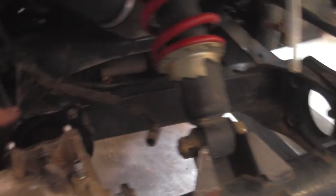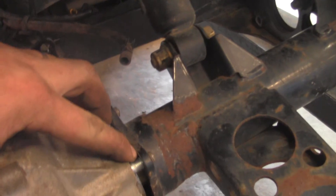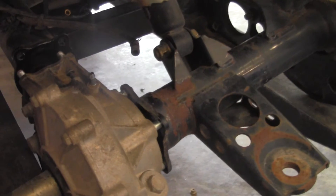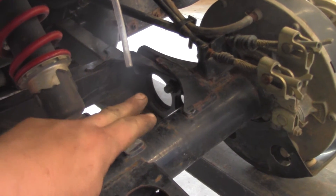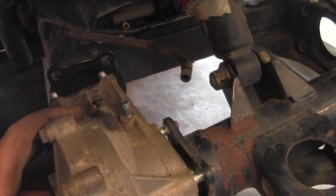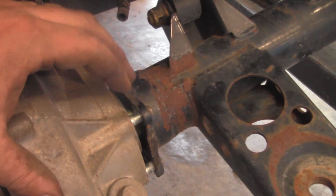It's going to be really easy. There's four bolts here — I've already got it separated a little bit — and then four bolts here, so eight bolts total. Here's the tricky part: these four over here you're going to have to do two; you can access those on the other side of the frame. We have both rear tires off. Once you've got these four over here off, that axle will slip away enough. You have those four nuts off here and it'll slip away from the main frame. Do those four nuts there, then let it slip left and right on the axle.